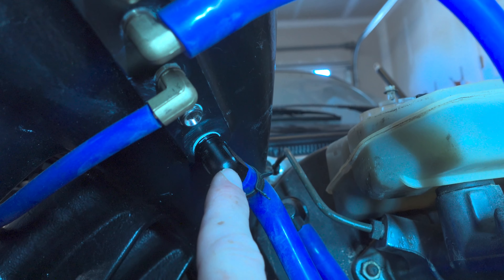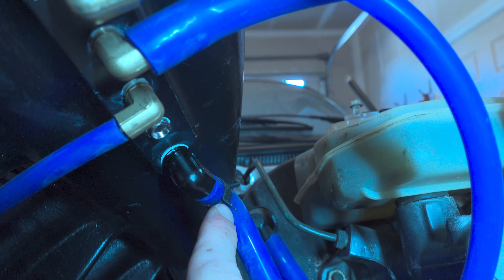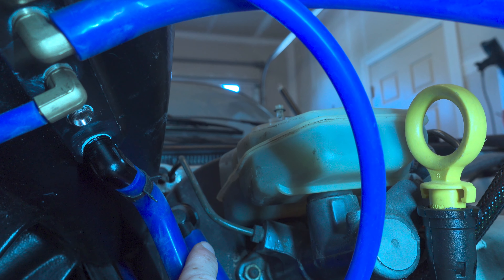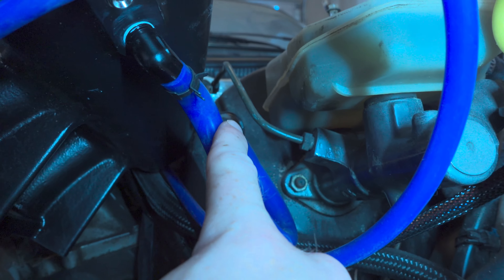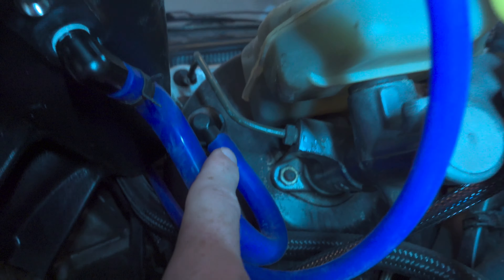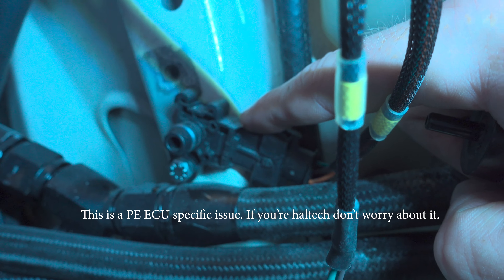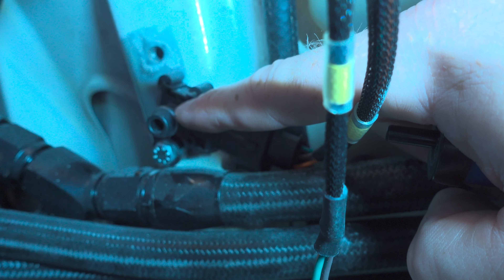You'll have to forgive my intake — I'm having trouble taking it all the way off because of these plugs and I don't want to force them, so this is going to be a little difficult to see. Vacuum is generated out of the bottom of the intake here. You can see there are six slots, so if you have six accessories needing vacuum these are what you'll use. There are two 1/4 inch MPT holes. In this case I have one plugged off with a 1/4 inch MPT plug and thread sealant around the threads to prevent vacuum leaks. The other 1/4 inch MPT connection goes to a 90-degree 3/8 inch connector and runs all the way to the brake booster. The brake booster on this one actually broke and I had it replaced, and that connection provides the vacuum needed to make sure you can brake.